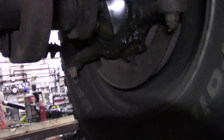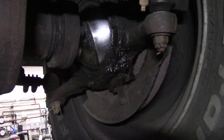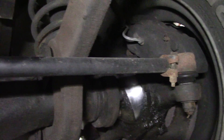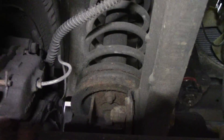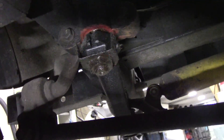Looking at the front — obligatory leak out the swivel but not that bad. Looks like it's had a new tie rod at some time. The army stuff never seems to put springs on upside down — they haven't even bothered with this one. All the springs are on though. Steering box looks like it has been leaking but somebody's put a new seal in it.